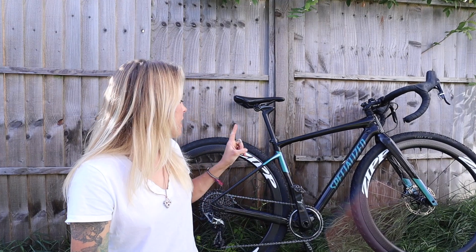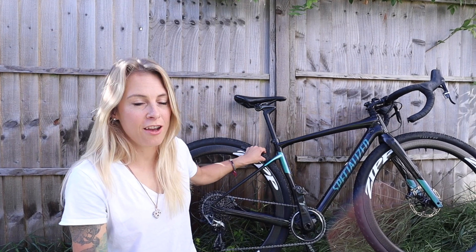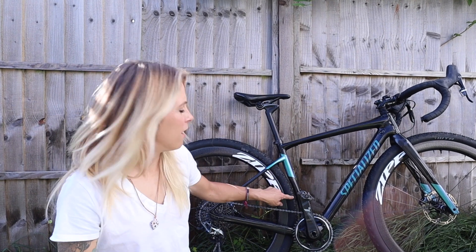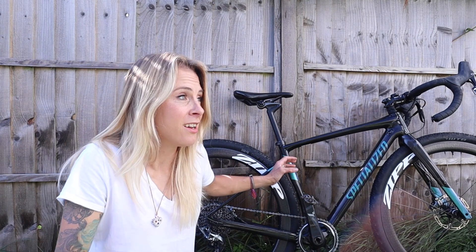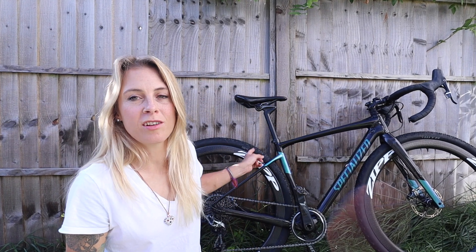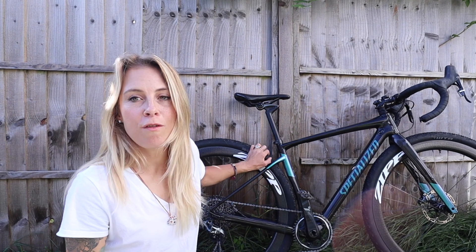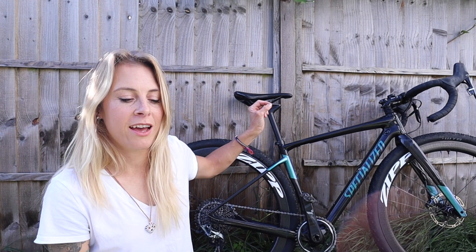It's got through axles, as you would expect from a bike like this. My tyres — I did change those too. It's got clearance for up to 42mm tyres but it's tight. I've put on these WTB Nanos, they are 40mm wide. I'm not convinced you could get a 42 in there but they say you can — I guess it depends on the tyre and the tread. I fully recommend these. WTB sent me a whole load of different gravel tyres to try out and the Nanos are the ones I've stuck with. I've left them on pretty much all season and I've done all different kinds of racing and riding and they've really stood the test of time. These are tubeless, so there's no inner tubes — I've got sealant in there. Very importantly, I learned how to repair a hole in a tubeless tyre, which came in very useful in Tuscany, so don't forget to learn how to fix tubeless tyres and take a tubeless repair kit with you if you're going to be riding this kind of bike.